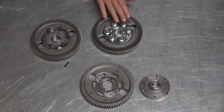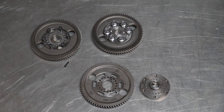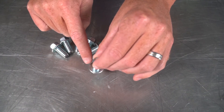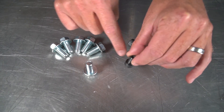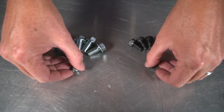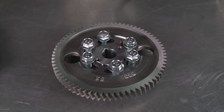With this gear on our UCC truck right now, we've had no slippage even at more power than we ran at UCC, so it works really well. And with the large flange head bolts, you will not have those nasty distortion marks because the flange head spreads the load over a much larger area — less pressure per square inch under the bolt even though total clamping force is much higher.